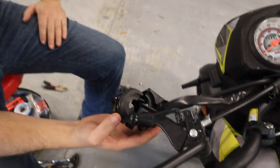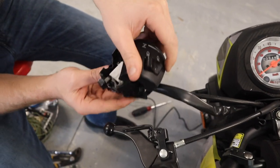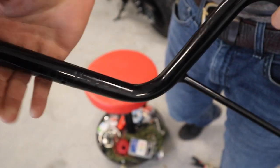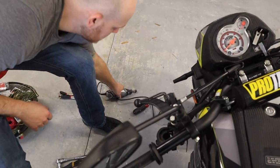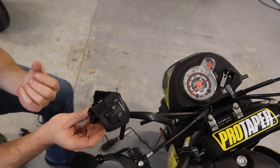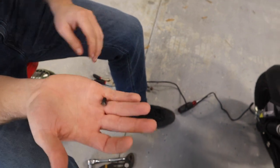When putting controls on new bars using the same stock hardware, Honda loves to put little pins in drilled holes inside their stock handlebars so your stuff doesn't rotate around. The easiest way to get them out is to take a Dremel with a standard sanding wheel and grind it down — you'll notice the glue will start pushing the pin out, and once it gets warm enough it'll just drop and fall out. For example, that's the pin right there — you can see all the melted plastic, still really hot.